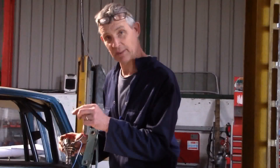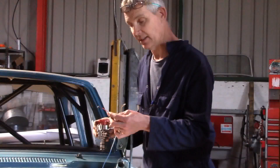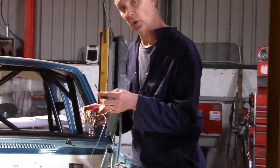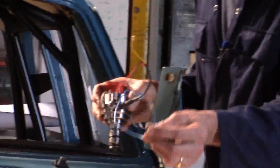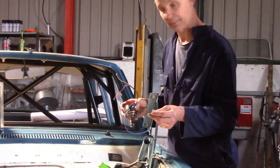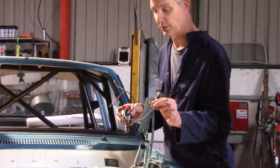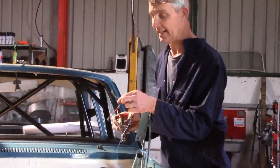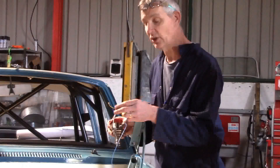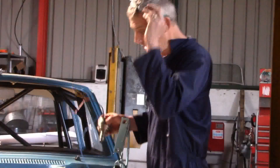To recap the wiring: the red cable is plus 12 volts ignition power; the black cable goes to coil negative; the blue cable goes to earth; and the yellow cable either gets earthed if you're only going to use one curve, or goes to a dashboard switch that selects between earth and 12 volts. Let's put it in now — I've already turned my engine.